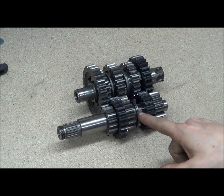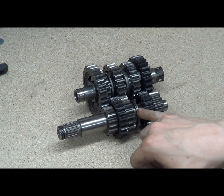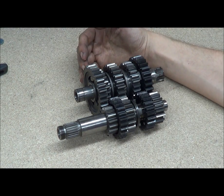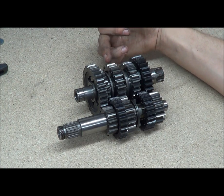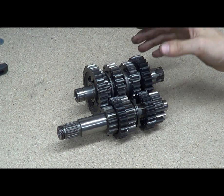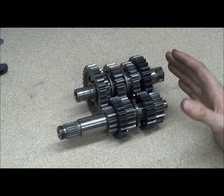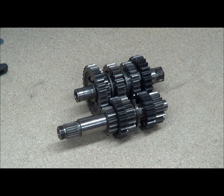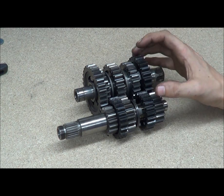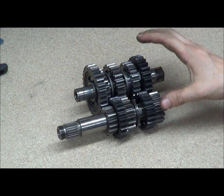The reason why I can tell first, second, third, fourth, and fifth is literally because of the size — number one is the smallest, then second, biggest, third, fourth, and fifth. Which correlates the other way around on your output shaft, so first is the biggest, second, third, fourth, and fifth. Basically if you add the diameter of both of them together on every single gear, you will end up with exactly the same number — otherwise the shaft won't line up. And if you add the teeth together, they will probably be exactly the same, because they're all the same pitch.